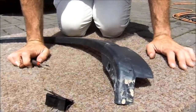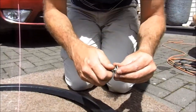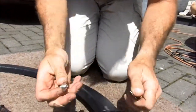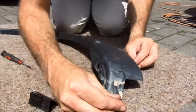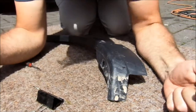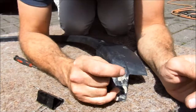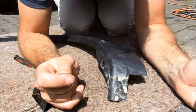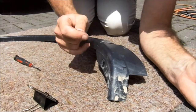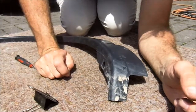They say eight millimetres, but I'm actually going to make it ten, and the reason I'm going to do that is that these fittings have some quite large washers on them, because this is going to come through this side and then be bolted on the other side. Having a slightly larger hole will allow you to line up the mud flap perfectly, so that if you've drilled the hole slightly off where it needs to be, you can make sure the mud flap sits nice and flush. So we're going to drill these holes now off-camera and come back in a minute.